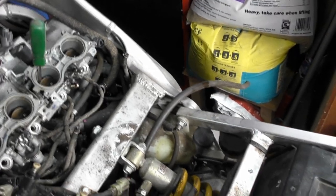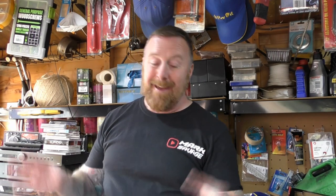That is all I can do now. I'm going to put it all back together with fresh oil in there. I haven't changed the filter because I've only got cheap oil and I wouldn't leave that oil in there, but it's got to be better than the crud that was in there. Coolant looks okay but the reservoir's empty — that must have been where it overflowed — so I want to top that up. But none of it's worth doing yet because I still don't know. When I've had it running a couple of times using some easy start down the air, she's revved up very slightly.